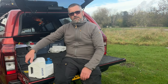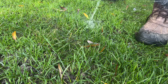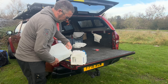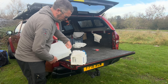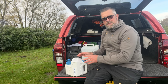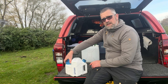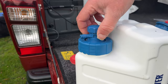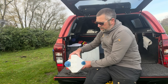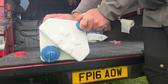So that's 10 minutes up. All we need to do now is discard the water and fill it up again. The next thing we need to do is pump this 20 to 30 times. But before we do that, the best thing to do is just release the top of the tap. Turn the tap slightly so it's facing at 90 degrees. Once you turn it to its side, you can pump 20 to 30 times, and then we're going to release all of the water through the tap.